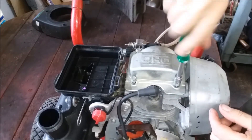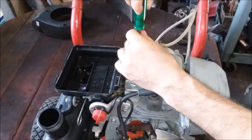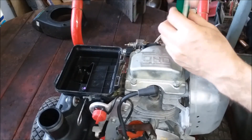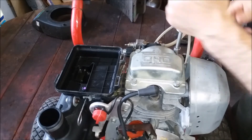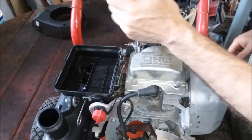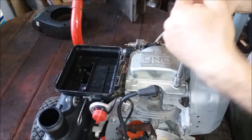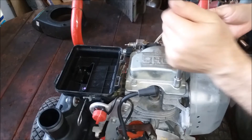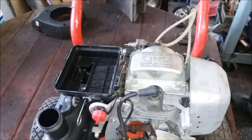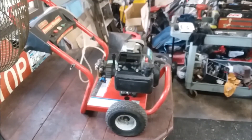We're going to use this nut driver adapter to get them started, and that's why I like to use hand tools — especially the quarter inch drive — for a lot of things on these little motors. These are small engines, it's not auto mechanics, it's not rocket science. We're going to use this to snug it so that I know — there we go. That'll still allow it, because we don't want to compress the gasket goop out of the way yet. At the very least you won't get junk in the motor or drop something in there while you're finishing up, and it'll allow it a chance to do its thing without you destroying it.